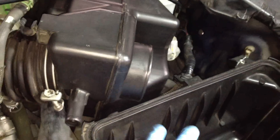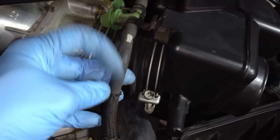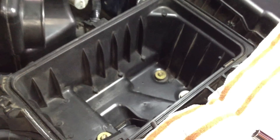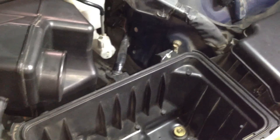To remove the air intake that goes to the air filter, we unscrew the two hose clamps and pop the whole unit off. I disconnected this hose — there's a clip here and a clip in the back that it goes into. I'm replacing this hose because it's very cracked and kind of dead on the end. It's also a good time to clean the inside — I just vacuumed it out and wiped it down to give it a nice clean before putting everything back together.